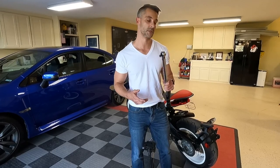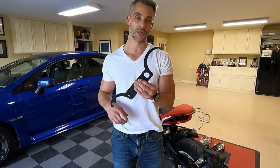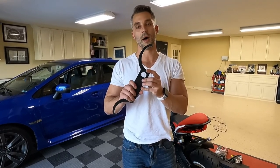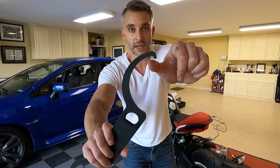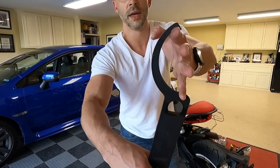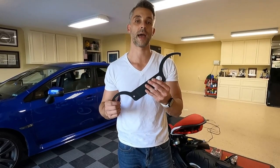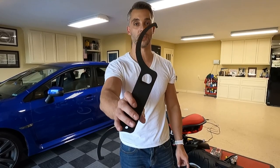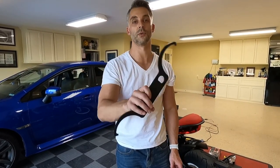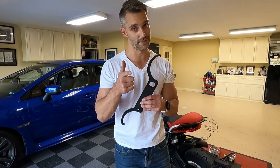The second tool — this is where we get into the brand-specific item. What I've got here is a spanner wrench. The spanner wrench is used typically on a castle nut. It's called a castle nut because if you look at the top of a castle it's got those little up-and-down sharp square edges. This will hook on to one of the square edges, this diameter will hold against the outer diameter of the nut, and you can turn it.